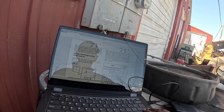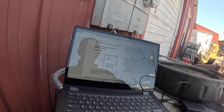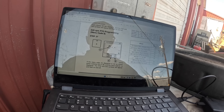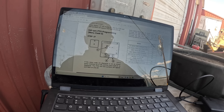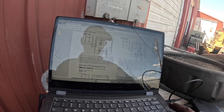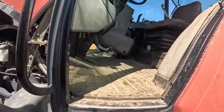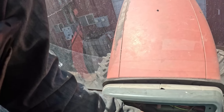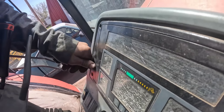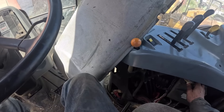Okay, I think this is it right here. 540 RPM PTO programming, menu code 8, step 27: if the menu code C displayed is not as shown, press switches A or B until menu code 8 is displayed. The PTO and 540 symbols will appear and flash on and off. Let's see before I get too far ahead — I'm going to plug the instrument cluster back in.